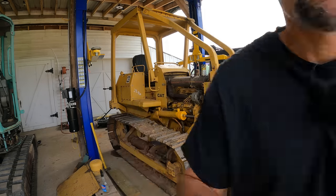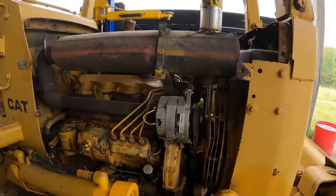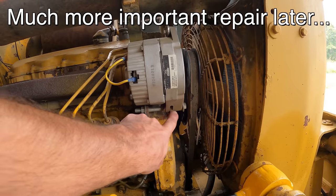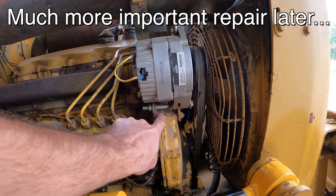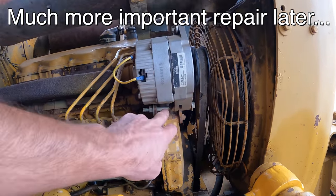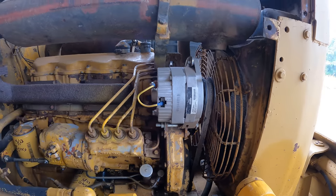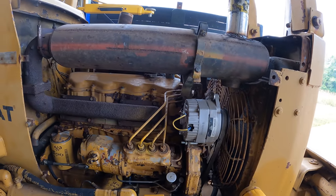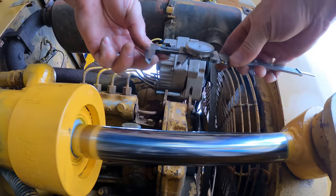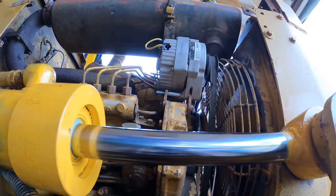And many of you pointed out, and I knew this, I was kind of cutting corners. I didn't put a spacer in here. So now when I'm squeezing that bolt down, I'm actually kind of bending this bracket a little bit, and I'm not able to bolt it properly. So I'm going to machine a spacer for that, and we're going to adjust the valves. We'll start out with those two things. Looks like 1.2 would be good.